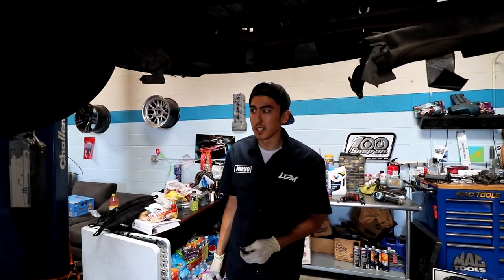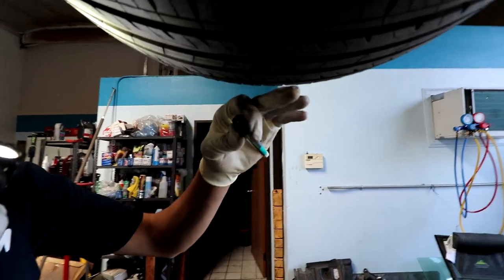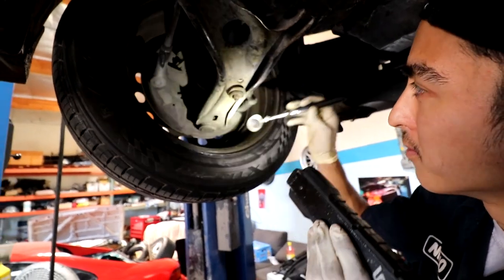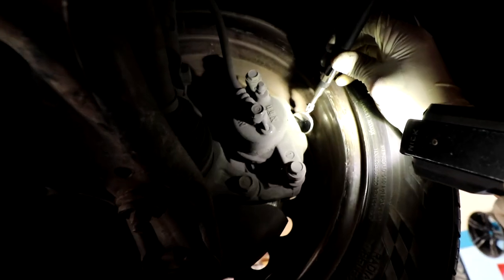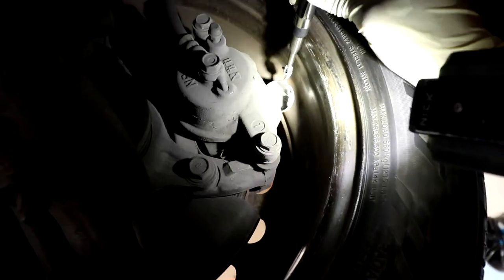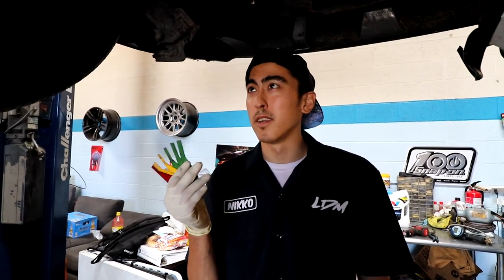Now that you've got the oil draining, you can finish up the inspection on the bottom of the vehicle. I'll usually go around and check tire tread, make sure all the tires are good — check for any kind of uneven wear, flat spots, something that would indicate it's time for new tires. After I check the tires, I'll go ahead and check the brakes. Usually with the mirror you can sneak it in there. You can see at least the inner pad from the back to give you an idea. If you're very new to this, I recommend just taking off the wheel and using one of these brake inspection tools so you can get the legit measurement. After a couple hundred oil changes, you'll get really good at eyeballing the brake pads.